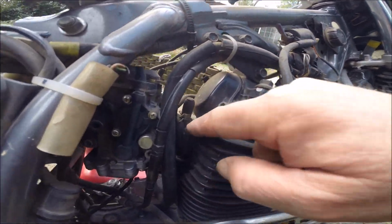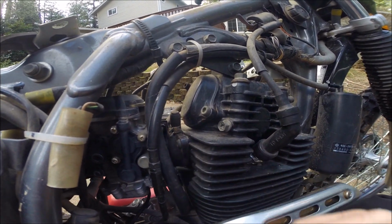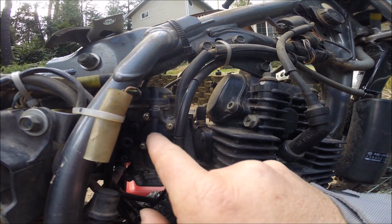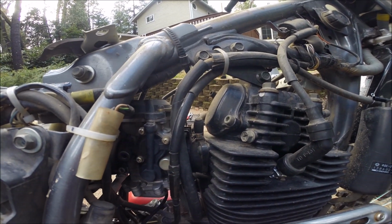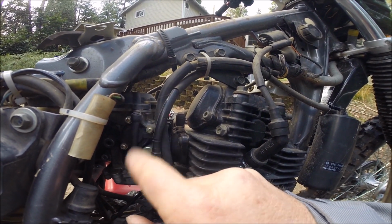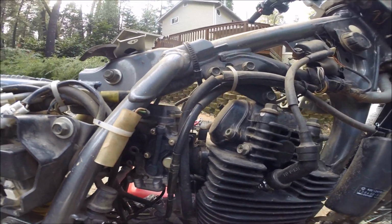Oh boy, look at that cracked old intake. Yeah, might as well renew that. On these carburetors, this is a piece of plastic, and it sometimes can develop cracks, which result in induction leaks and popping and banging and lean running. And there is a source to replace this without having to replace the entire carburetor. So take a good look at that while you're in here.